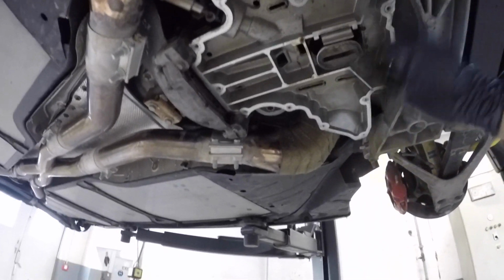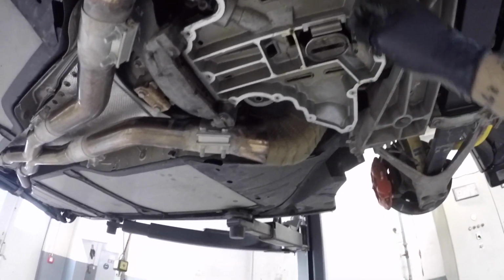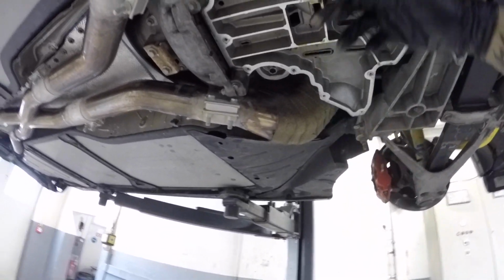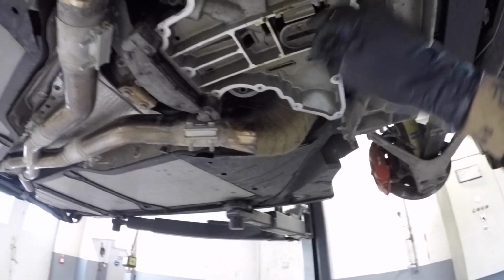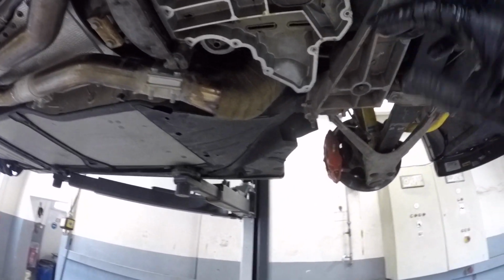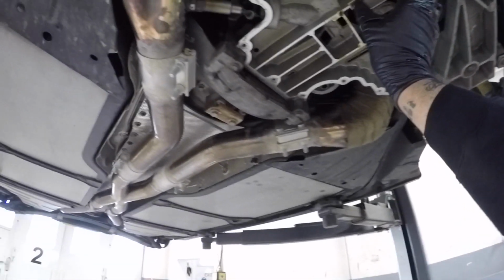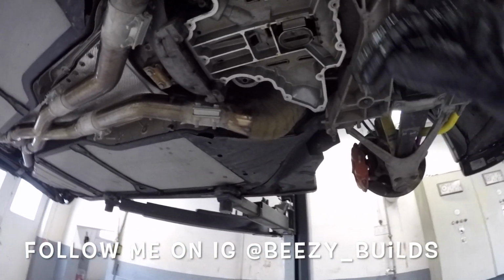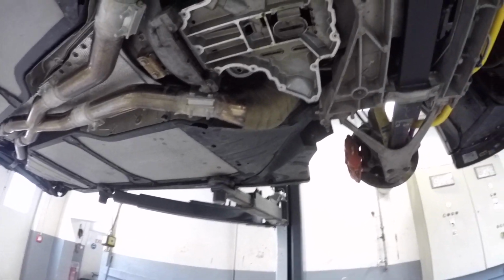So that is the way that it's supposed to work. The next step, I will be installing all the oil pan baffles, getting the final fitment. I'll show you guys once they are installed. They install pretty easy. They literally just click in and you give them a couple taps and they stay there. The way they're held up is by the lower oil pan. It will touch this and hold it in place so they're not able to move. So that's the way those work. I'm going to get the final fitment, and I'll show you guys from there.